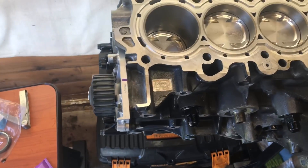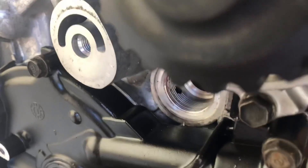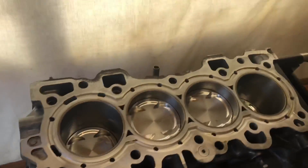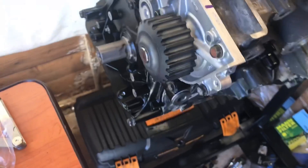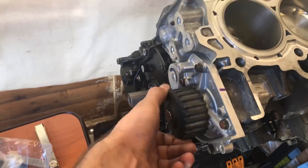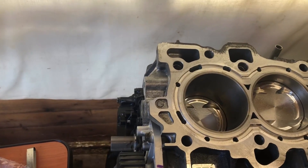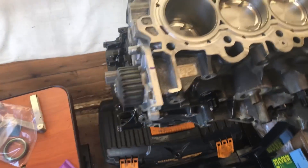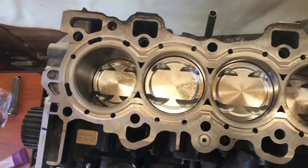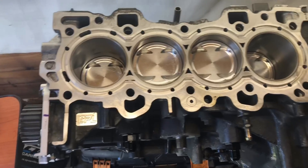Water pump's installed - and me not paying attention, I forgot I've got to put a core plug in there. I've got one but I haven't got the right size socket to seat it at the moment, so I'm gonna go get the right size, put one in with Loctite so it ain't coming out. Water pump's installed though - all brand new, very nice and fresh, put a bit of seal on it. Now I'm gonna have some late breakfast and then get back on it, get the core plug installed, get the head on, and go from there.